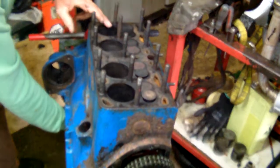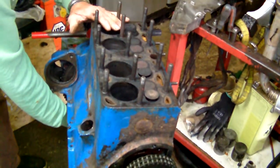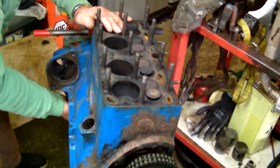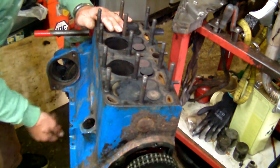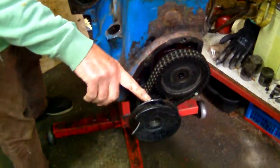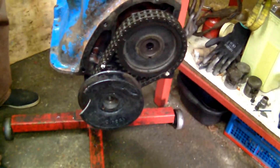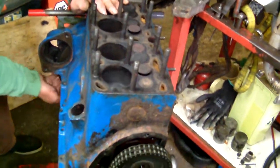Now we're exhausting on that one. This one — that valve's shut, so whatever it's sucked in there is now being compressed. This one is getting rid of the burnt gas. This one is now compressing — it will fire now. Number four firing at TDC. And I still have difficulty conceiving all of that, but okay, we'll go through it once more.